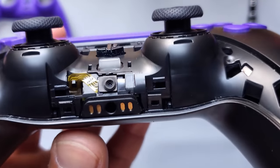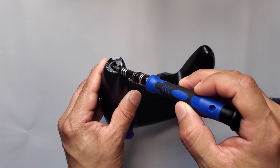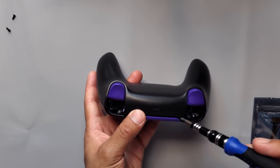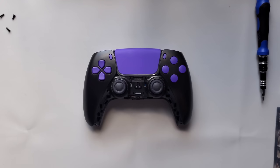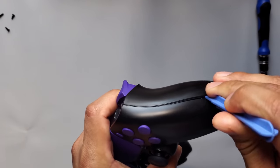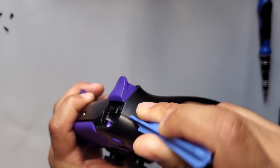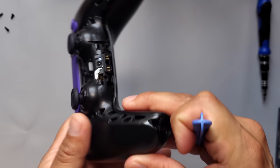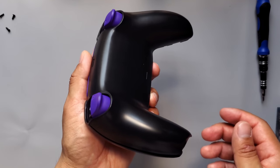You're going to see how you'll be able to remove the front shell after you take off the screws. There's a total of four screws — one here, another one here, then under the L1 and R1 buttons you have another set of screws, and here's the last one. Now grab your prying tool again, dig into one of the ends, and just push and pull back and forth. There are some locks around here — dig right into it and it should come loose. Then do the same thing to the other side.